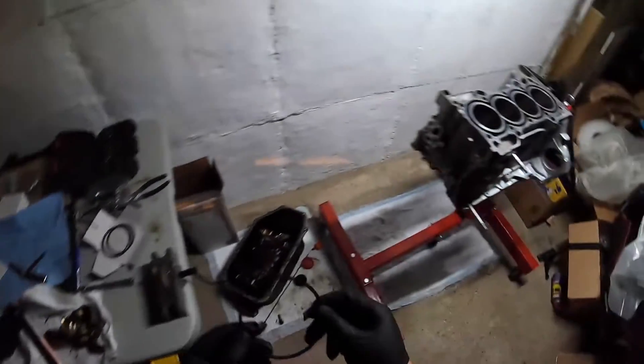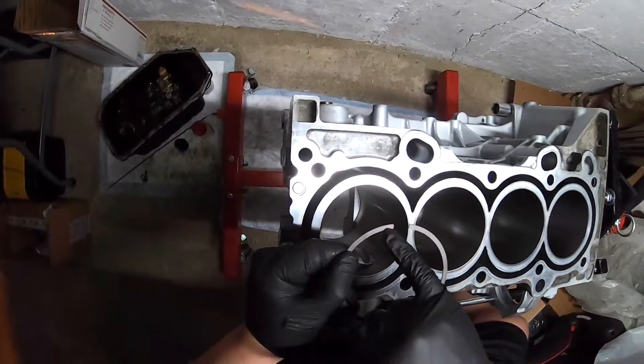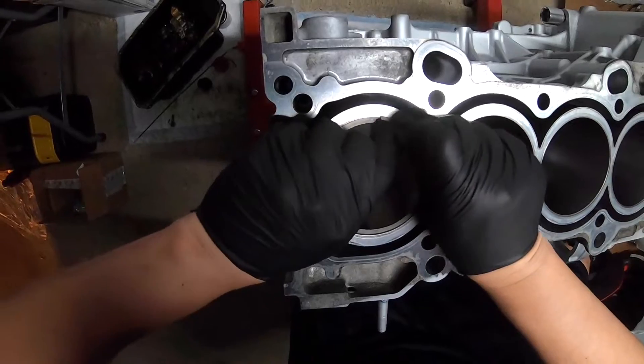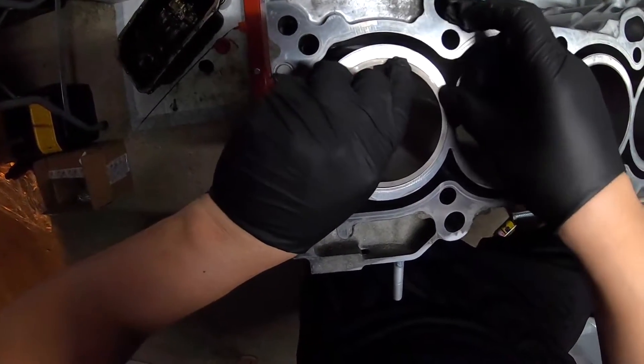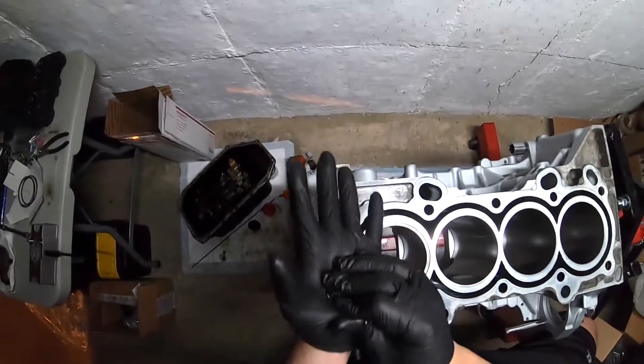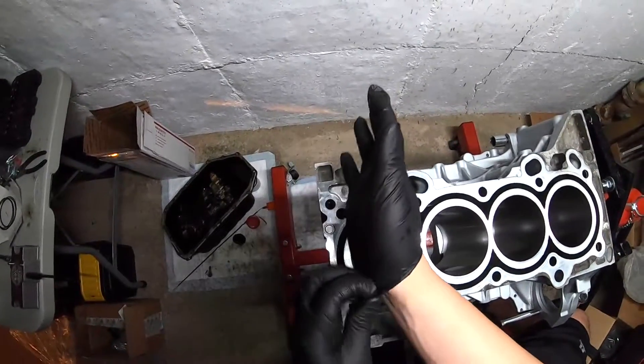You want to take the ring out from the rear. I'll label this ring pack one for the first cylinder, and then we're going to work on the second ring. Remember the rings have a marking on them to tell you which side is up. Put the ring in, and that's basically the process on how to gap your piston rings. Just follow the same steps for the remaining first ring and second ring.